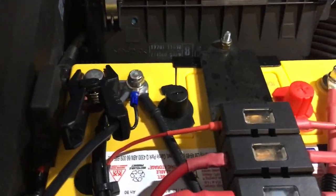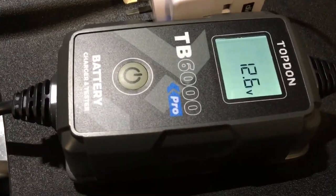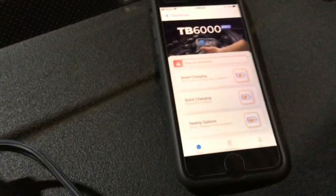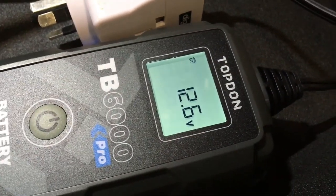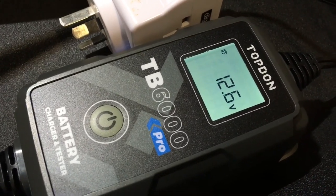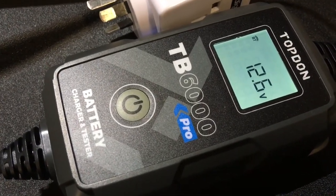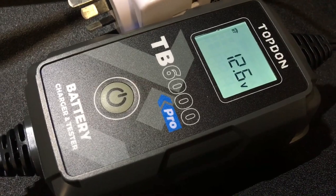I'm taking the caps off — actually I'll keep them capped and just put the alligator clips on the battery. As soon as you do that it fires up and powers up the charger. I'll open the app — there it is, connected already. Smart charging — it says plug not connected, so we've got to plug that lead in in a moment. Battery is showing 12.6–12.7 volts. It was on 12.4 earlier because the vehicle had been sitting with a phone charging off it and volt meters running.